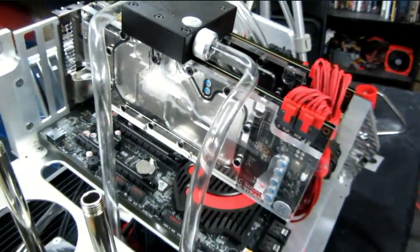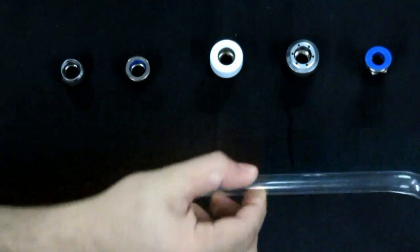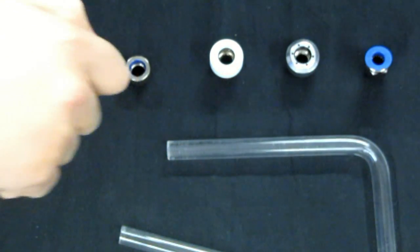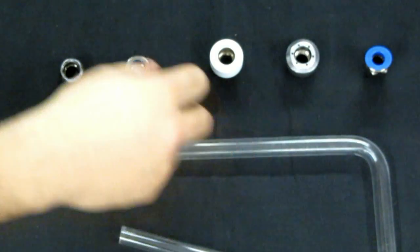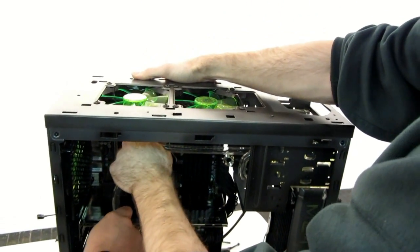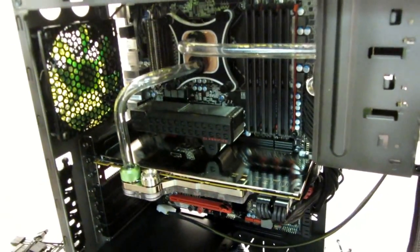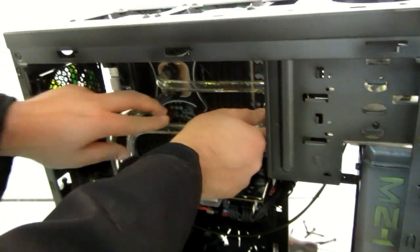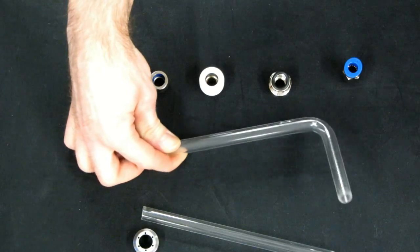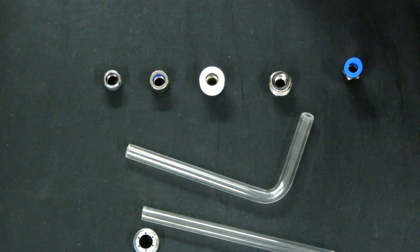For personal use, I've found it's easier to install tubing into Primo Chill fittings because once you're working with hard line there's no space to wiggle — with push fittings you can't just grab and shove the tube in. Also be careful not to put too much stress on blocks: metal GPU and CPU blocks can handle it, but acrylic blocks can crack and leak under too much stress. Similarly, the acrylic tubing itself might fracture. That's why leak testing with distilled water is so important.